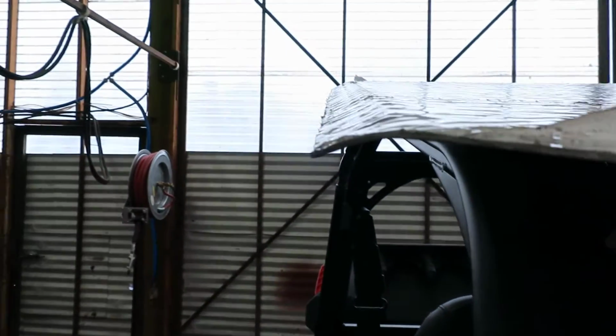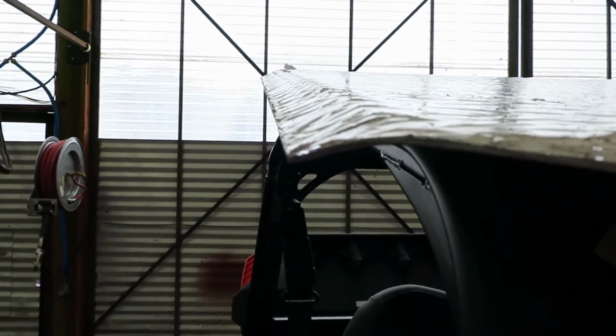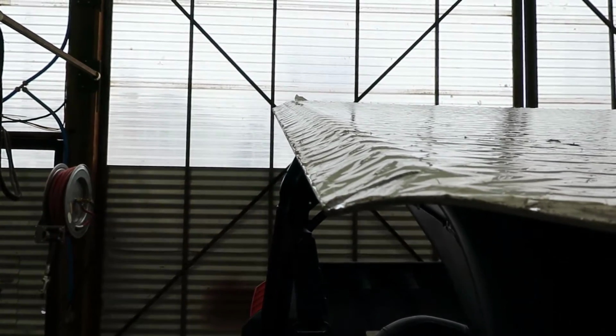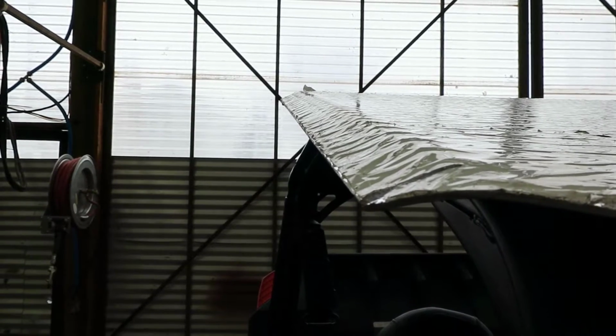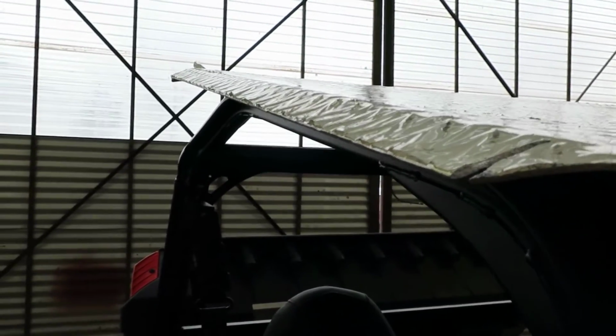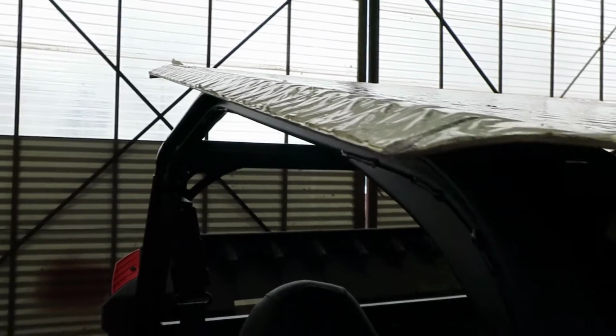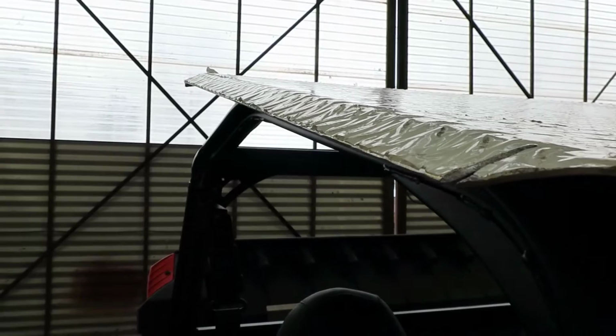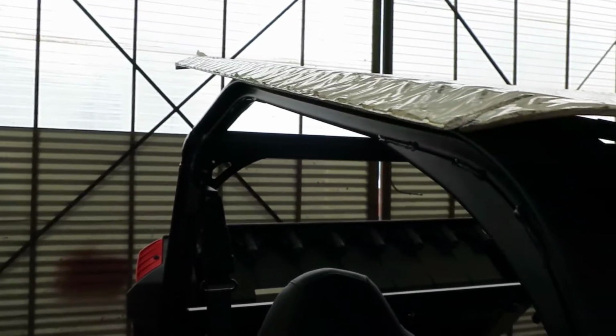So anyway, we put this in the press. That's a 1.5 inch wide bend there, and I'm shooting for somewhere around 22.5 degrees. I never measured it when I got done. I just got where I liked it, and we set the brake up so they're all the same.